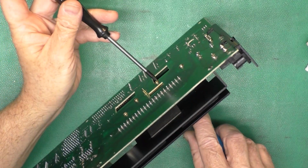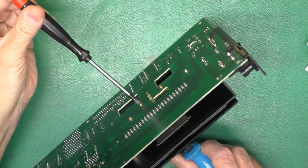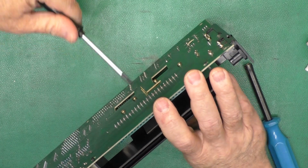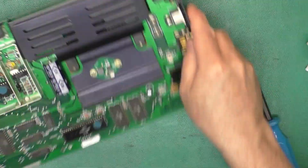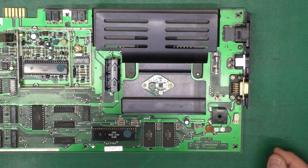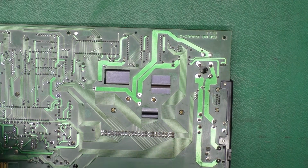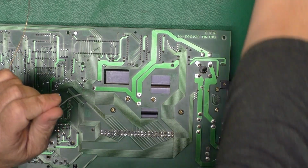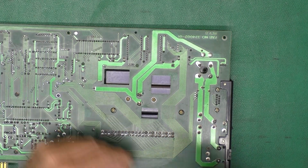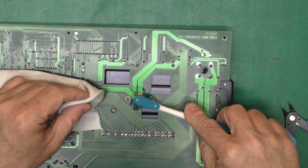So for this, we're going to hold the nut driver on one side, screwdriver on the other. Snug them both up. These don't need to be excessively tight here. We are just clamping down to a circuit board, but there we have our nifty switching voltage regulator in place. Okay, there we got him on there, and we need to solder this guy in place. And I'll trim those pins. Going to clean up my mess from soldering here.